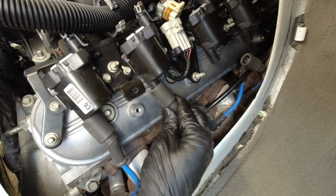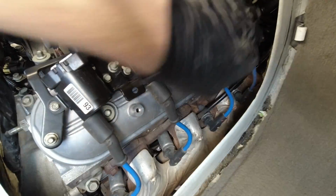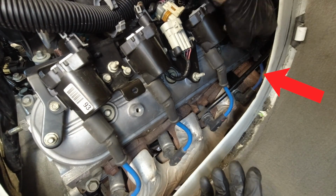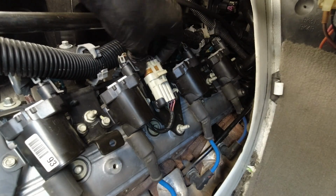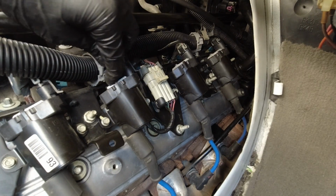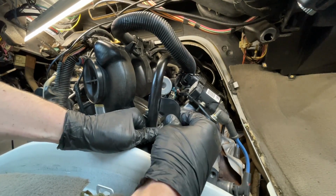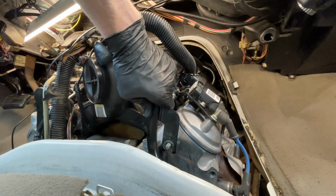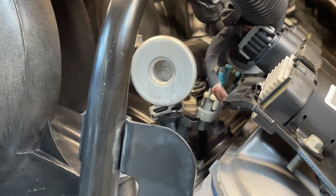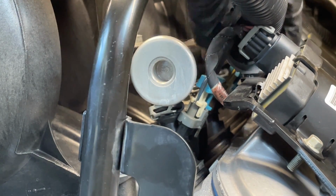Then the plug wires. And make sure that you route your cylinder number 2 plug wire below the dipstick tube and not over it. Reconnect your coil rail harness and re-secure the engine harness in those 2 clips. Then finally put your transmission dipstick tube back in place and tighten that 13mm nut. Now be careful, I did have one of my fuel injectors come unplugged during the job, but I think that's only because the clip was already previously broken.